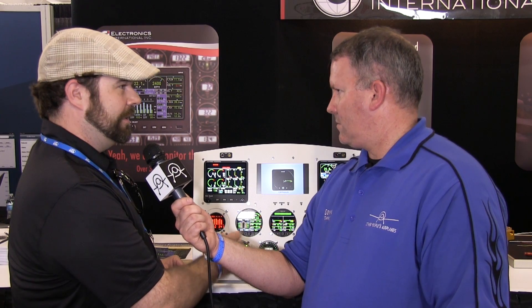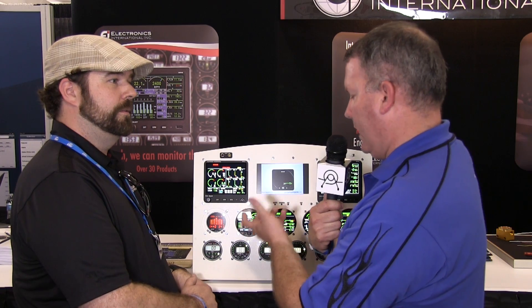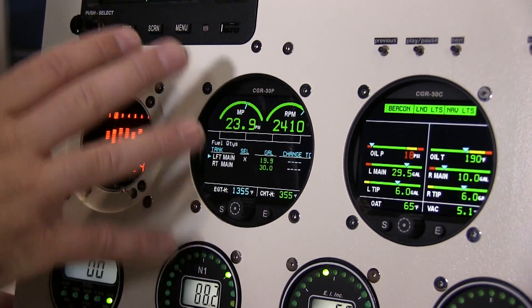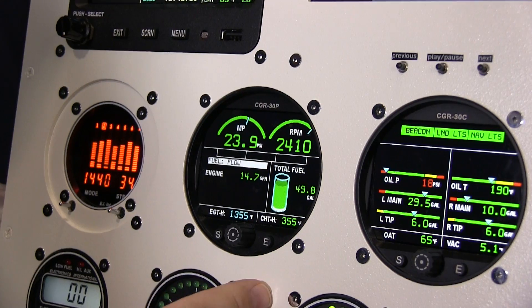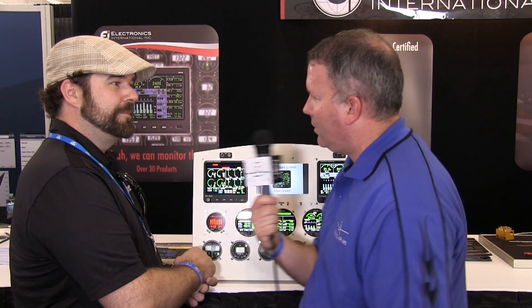We also have an EGT and CHT graphical depiction of your engine. You also mentioned that this had let you know how far you could go with your fuel. Absolutely. Because not only is it an EGT and CHT bar graph, but it has a complete fuel totalizer on board. The totalizer is actually back here, and it will differentiate up to four different tanks — so it's not just a single fuel flow and single remaining, but it will actually tell you exactly what you have in each tank. It'll tell you your fuel flow and your range, how far you can fly. It picks up your current speed from your GPS, then calculates based on your speed and fuel flow how far you can go.